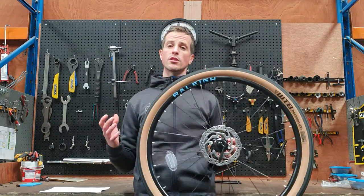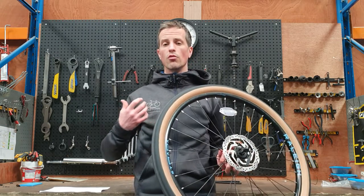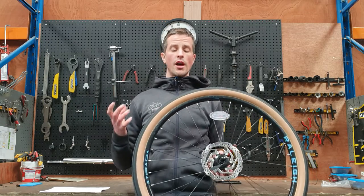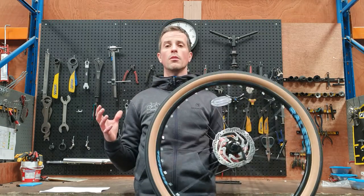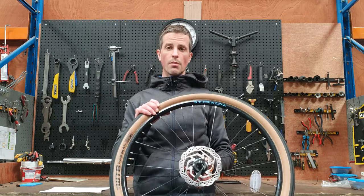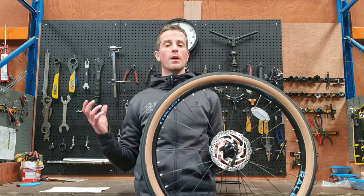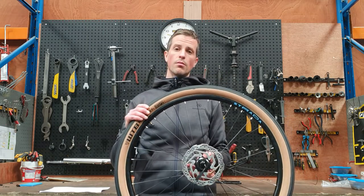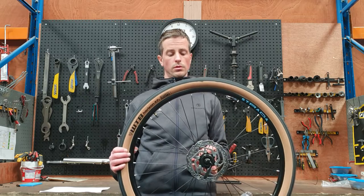It's also really important to note that rolling resistance isn't everything — there are other factors that play an even bigger role, such as wind resistance, which is where you see a lot of road cyclists in really tight-fitting lycra, and gravity itself on the hills. Tire choice can also make a massive difference, so don't over-inflate — try to find a sweet spot. Bear in mind the conditions and terrain you're riding on: 100 PSI might fly on tarmac, but 85 is going to feel a lot smoother on rougher roads. Similarly, 40 PSI might feel great on tarmac, but once you hit the trails you're going to want to decrease the pressure for more comfort, more control, and better bike handling.